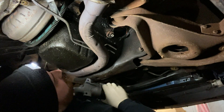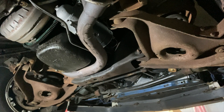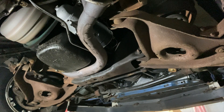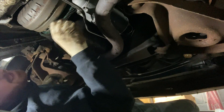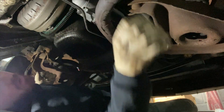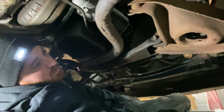Still sounds violent. I'm pulling that shim back out because it still sounds a little weird. I found the little pin spacer thing you're supposed to use to measure the clearance between the gear — not going to lie, I had to look it up. I found an Eric the Car Guy video. This little tool, which the first starter didn't come with, slides in between. Right now the gap is just massive, so I'm going to put a thinner shim in to get the right spacing clearance and try it again.